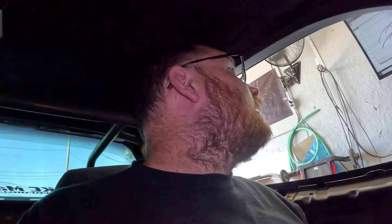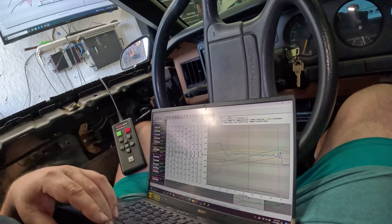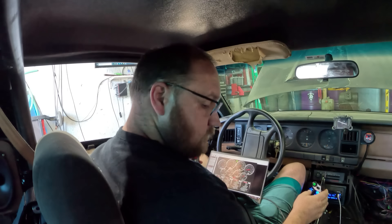Brandon says we don't have any leaks — yay! So now let's see if we keep those leaks at bay. Not gonna lie, kind of disappointing power numbers right now. I may have to do a timing verification check on it. We got 22 degrees timing, about two to three pounds of boost, and we made 390. I figured this motor would make like 440. Okay, well I might have some more boost — more boost.